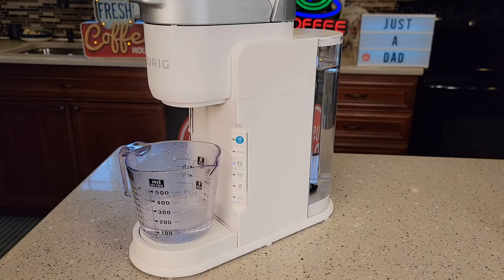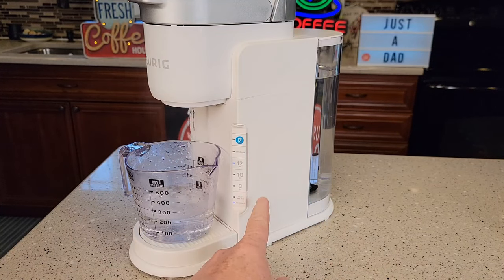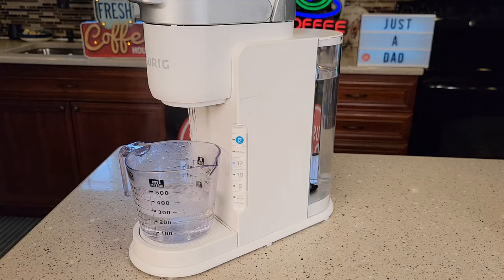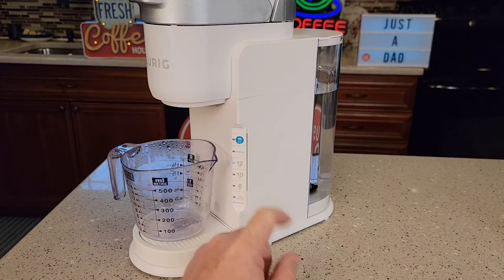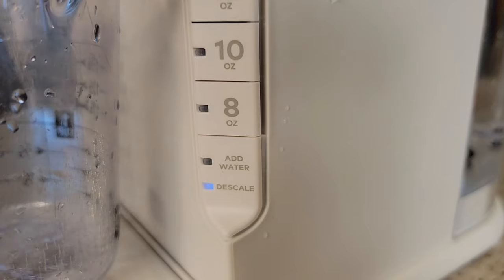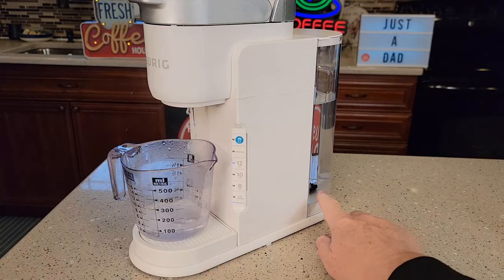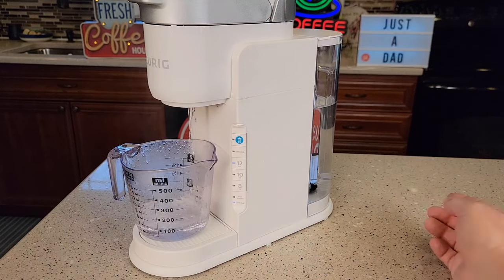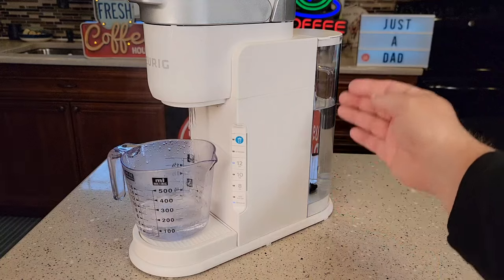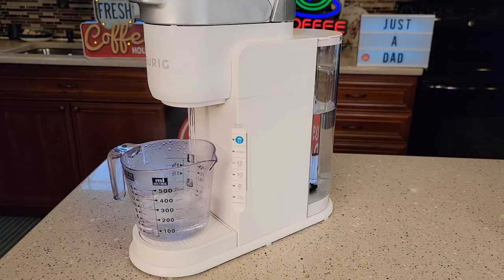After the fresh water rinses, it's going to come out of descale mode automatically. We're going to press the 12 again and dump that out until the add water light comes on. When the add water light comes on this next time, it'll come out of descale mode. If your add water light never comes on, keep an eye on it — don't ever run your Keurig dry, that's when the thermostat on the inside could trip. If the add water light's not coming on, you may need to unplug it and start over, or try priming the pump by putting the water tank on and off about 20 times. The add water light has to come on for the machine to exit descale mode.